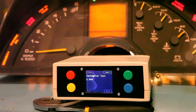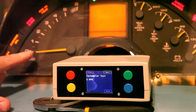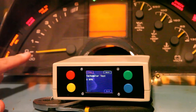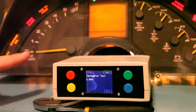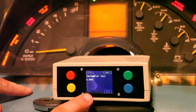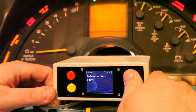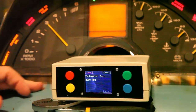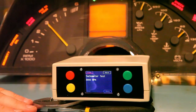The next screen is the tachometer test. The first test we see is zero RPM — the gauge should indicate zero RPM or very close to it. If it does not, that indicates the needle is not centered on the gauge. You should use a small pry bar to pry the needle away from the gauge face and reset it at zero while the instrument panel is being driven to zero RPM. We'll press next to go to the next screen, which gives us a half-scale reading — in this case, 3000 RPM.